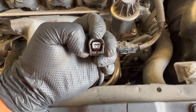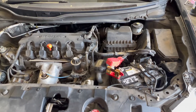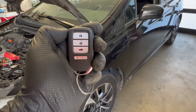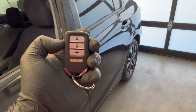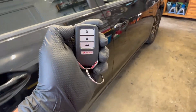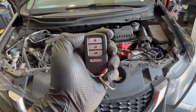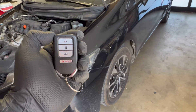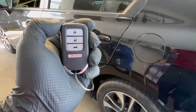Installing the jumper wire on the pins of the hood latch connector makes the car think the hood is closed. Make sure whatever you install doesn't spread the terminals open or it'll damage the connector. Now with hood and doors taken care of, I can install the multimeter. Something interesting I found during the walk-around: with the remote in my hand, walking on the driver's side nothing happens, but on the passenger side the car senses the remote and unlocks the doors. So with a smart key, lock the car and keep the key at least five feet away. That unintended unlock might be a clue as to where our parasitic drain is.